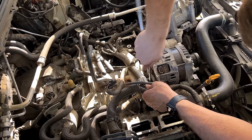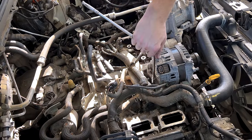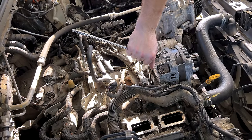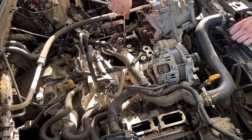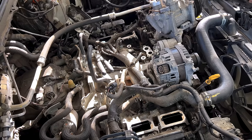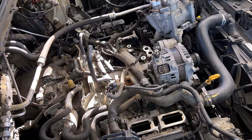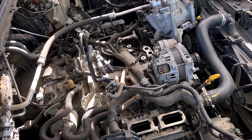The aggravating thing about all this is I'm going to have to come back and do it all over again on my 2013 Crosstrek that my mother's driving now — the coolant crossover pipe O-rings are leaking on it as well. Seems that's becoming a common issue with these cars as they grow older. With 231,000 miles on this car and 230,000 on my Crosstrek — both 2013 and 2015 — it's about time for seals and gaskets to start getting hard, brittle, and leaking. We'll snug down the bolts, torque to 6.4 Newton meters.